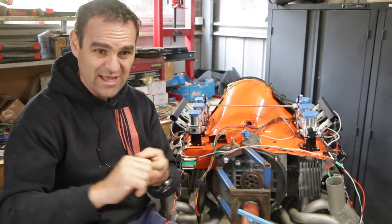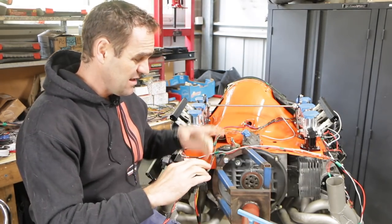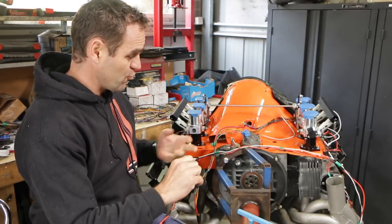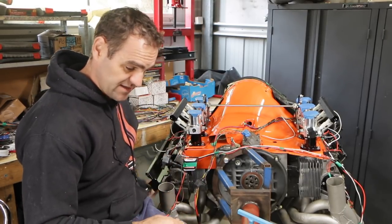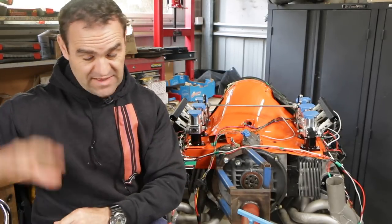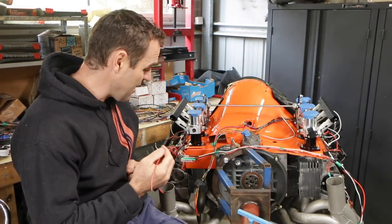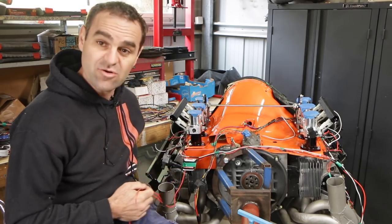As I mentioned last week, I'm going to have three separate relays for the ECU system. There's going to be one main relay which will run power to the ECU and the injectors, then two more relays in the rear of the car — one for the upper set of coil packs, another for the lower set. There'll also be another relay in the front with the fuel pump as a separate system. So I need to fix my power and ground wires for the lower set of coil packs.